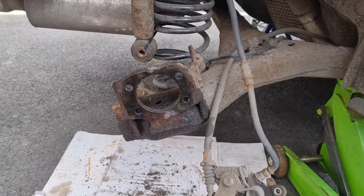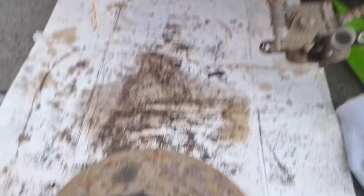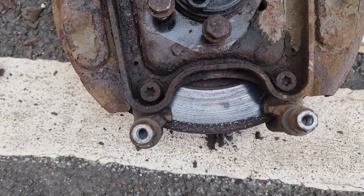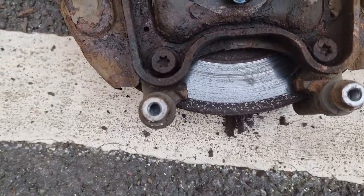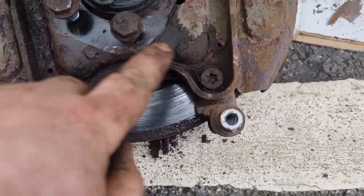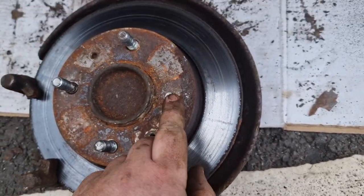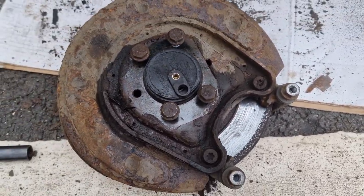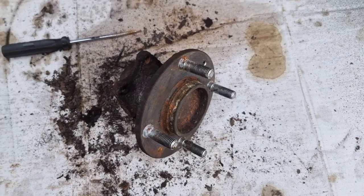This one decided to fight a lot harder than the other side — these bolts just would not come undone. Finally got them off, screwed them back into the hub. These two bolts here hold the caliper on. I managed to do one on the other side, but unfortunately I managed to snap my T50 bit, so I had to head over to a mate's and see if he could help me get them off. Once these two are removed, the caliper can come off, the disc can come off, and then the bearing will push through. Finally got the caliper bolts off — thank you to Mikey and Justin for giving me a hand with that.